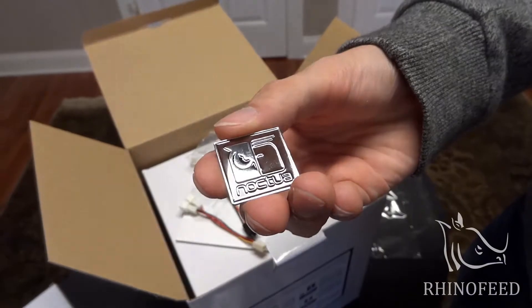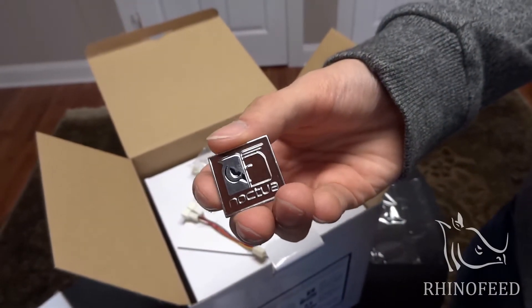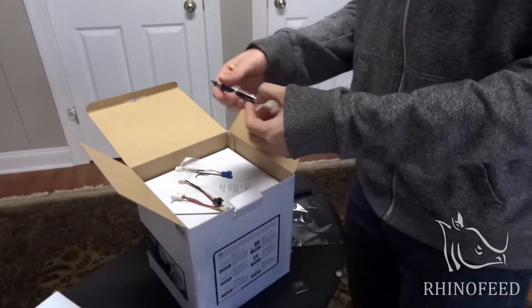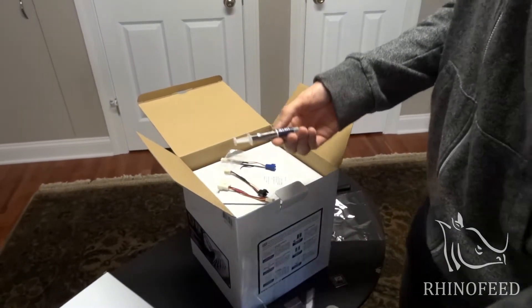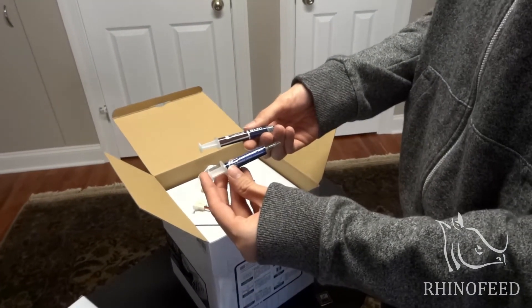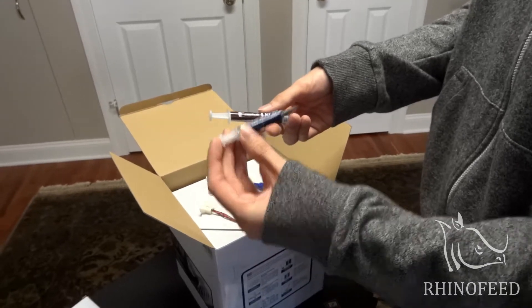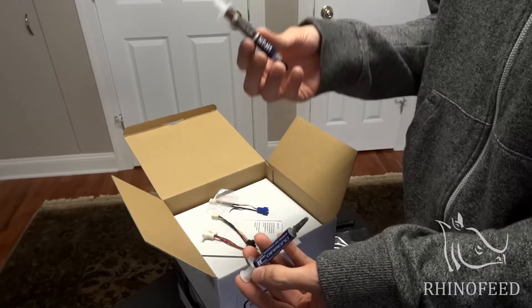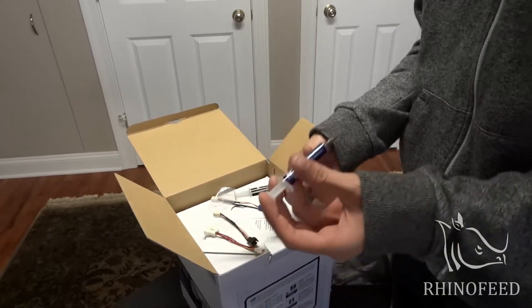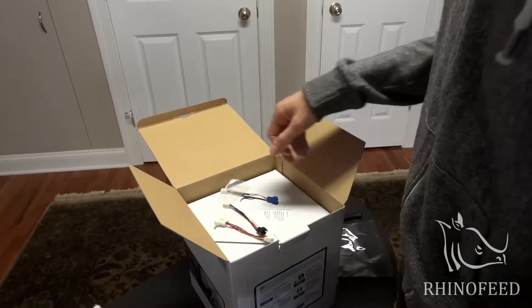I love their logo. Their owl is kind of sweet. Anyway, this is their NTH1 thermal compound. I'm actually going to be replacing this with IC Diamond's own 7 carat thermal compound. This actually performs about 6 Celsius lower than this one in people's tests, so that will help with performance and silence.